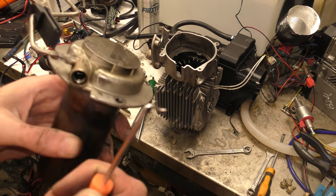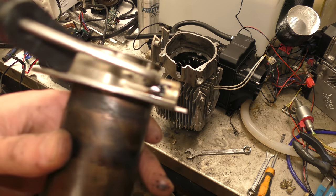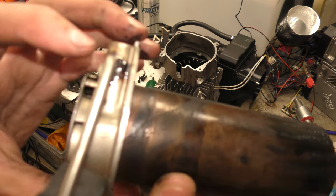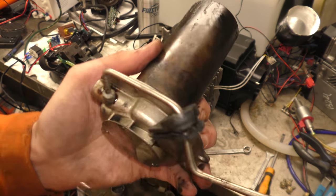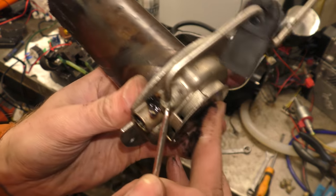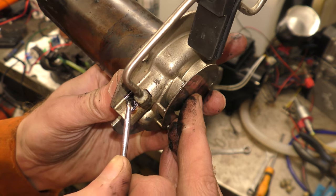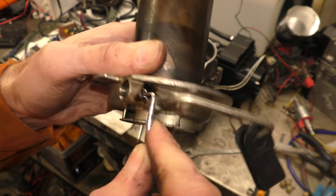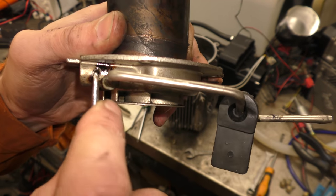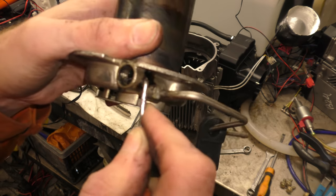I've returned with a pick. This little tiny hole here - if this hole is blocked, your diesel heater will not light or will be very very difficult to light. And it's chock full - absolutely solid.